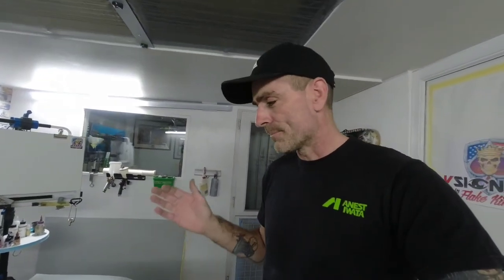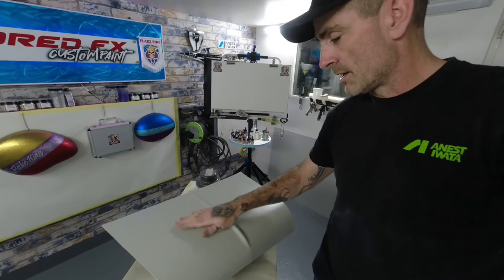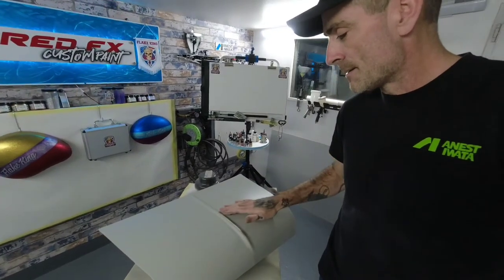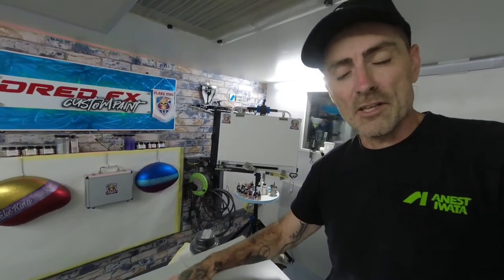I left you in episode 1 where we just put the hybrid primer down, done 4 coats of that. So there's the bonnet, it's all cured down nice overnight, and now we can go in on this next stage, which will be using DA discs. We've got some 320 grit and we've got some 500. We'll start off with the 320 on a block, start knocking this back, just go over nice and lightly, taking the many rough edges off, and then we'll go in with some guide coat.